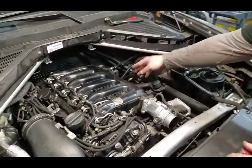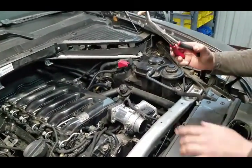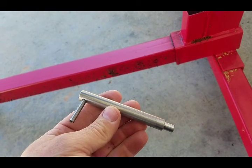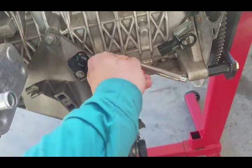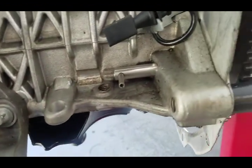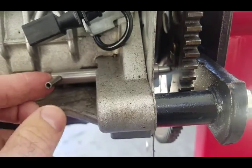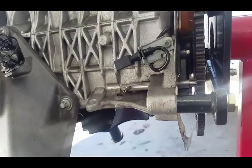I've already put the lock pin in the engine. The first thing I did was take a pair of pliers, reach down here, and pull out the plug. I'm going to overlay a video clip showing you how to install that pin. To use the flex plate lock tool, it gets installed on the engine block — there's a hole right here. Push the pin through. It's important that the pin go through the flex plate. Right now it is not locking the flex plate, so you need to turn the engine over while pushing the pin and it's going to end up finding a hole. That's how you use the flex plate lock tool.